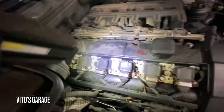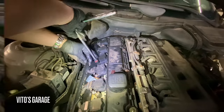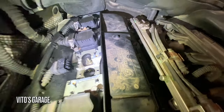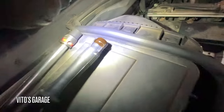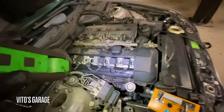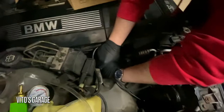Coil, there's like smoke. Well, this valve cover gasket needs to be redone. Where's the smoke coming from? From where the hole is, or no? No, seems like from the nut. Does it shake? Yeah, no, it's from this. I'm trying to take it off. Hold on. Definitely, right? There's oil in there too, in the spark plug hole. So definitely needs a valve cover gasket as well. Does it feel like a lot of pressure there or no? Not really. Just hold. So you're looking for air.